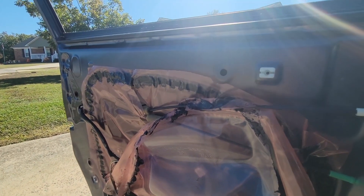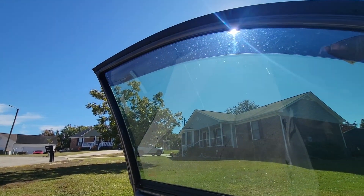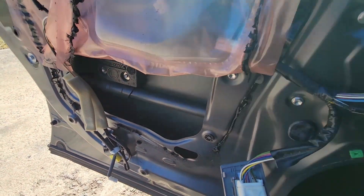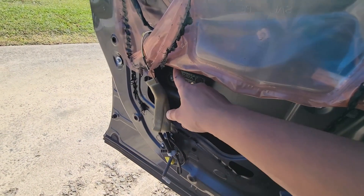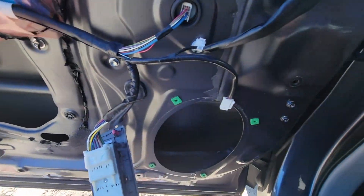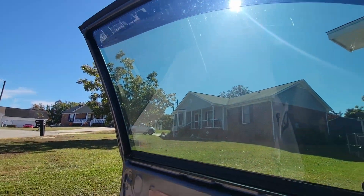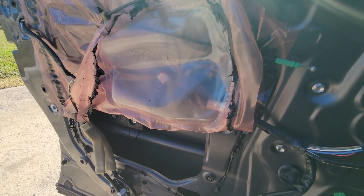So I got that one tightened up and also tightened up the other. Just put a little bit of Loctite threadlocker on it. Vibrations and stuff like that is why they would come loose. So now that it's tight, let's see if this thing makes that annoying popping noise when it goes up. Kind of helps if I push and clamp this thing down. There we go. All right, we are golden. So if you have a Toyota Highlander making that weird popping noise when you roll down your window, see if you're missing one of the bolts. Typically they should fall and be right in there — I just used a magnet to grab it, tighten it up, maybe use a little Loctite. The Mrs. should be happy and our bank account should now be drained with tons of coffee and other drive-through items. Thanks for watching, hope this helps.